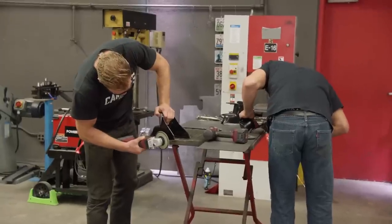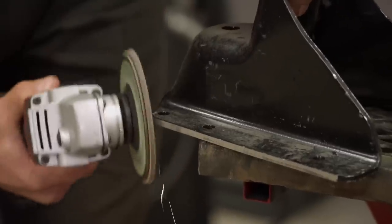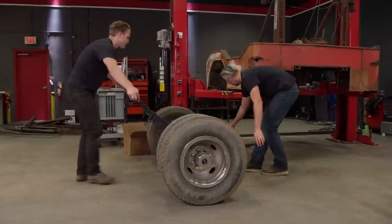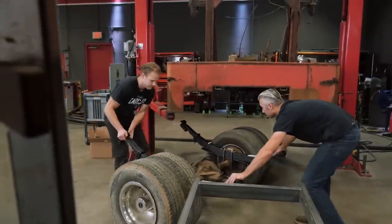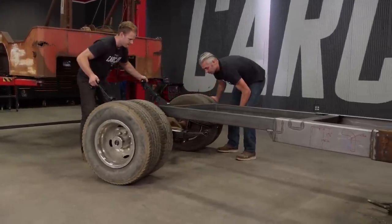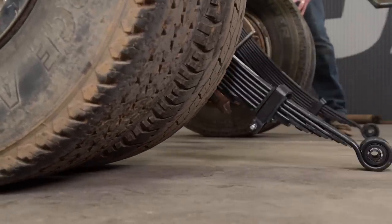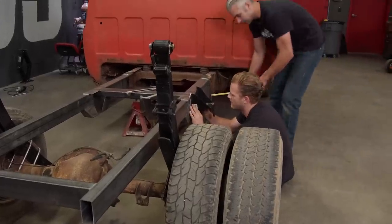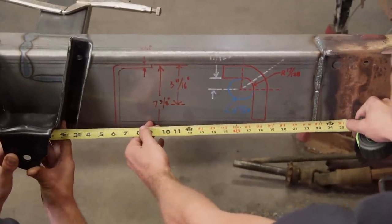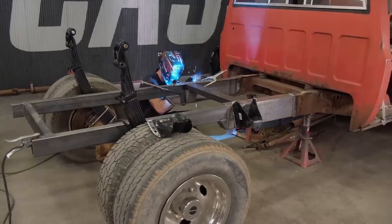With our axle prepped, we can prepare the front and rear leaf spring hanger mounts for a test fit. We're doing this because we're going to weld them to our new frame rails instead of riveting or bolting them. Many hands make light work when rolling a giant dually axle under a truck. We measured the wheelbase prior to cutting off the rear end of the chassis, so we have a good idea where to set it. We're measuring from the cut line to the center bolt hole of the leaf spring hanger — 22 and a half inches to center — to ensure we tack the hanger in the same area as our rusted-out frame section.